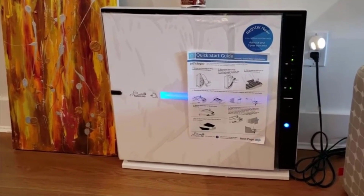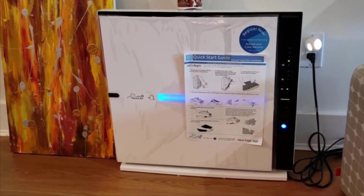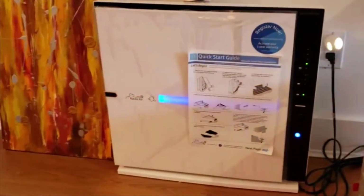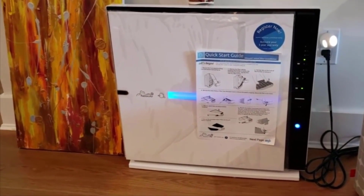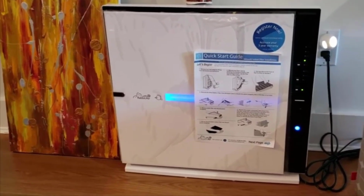What we would recommend instead is a 250 CFM unit in the $150 to $200 price range. You're going to get a HEPA filter with that unit. The Winix 5500-2 comes with a carbon filter with pellets for maximum adsorption of gases. If gas filtration is important to you, if you're concerned about VOCs or odors, that model is going to be a terrific choice, and that model retails for around $150.